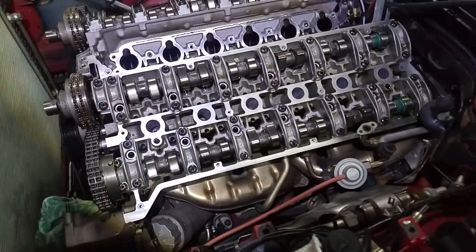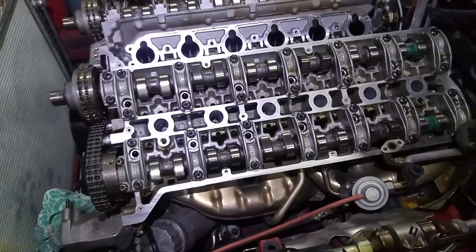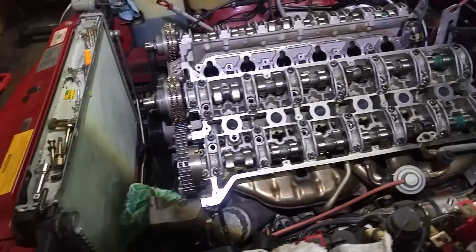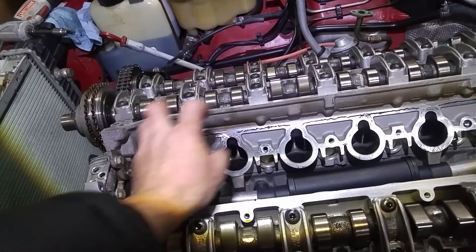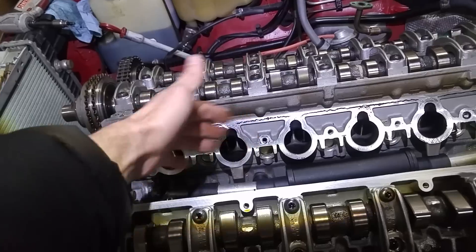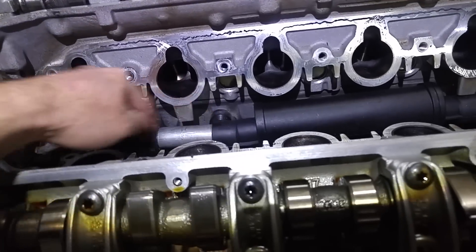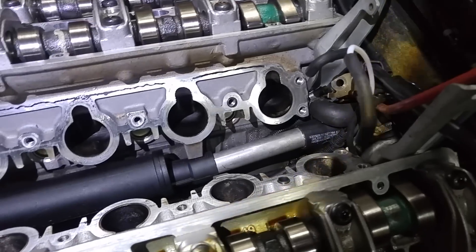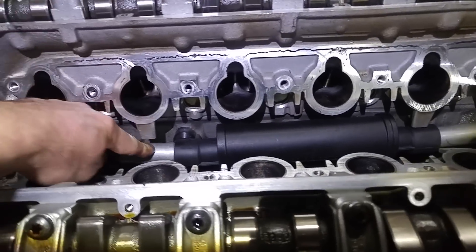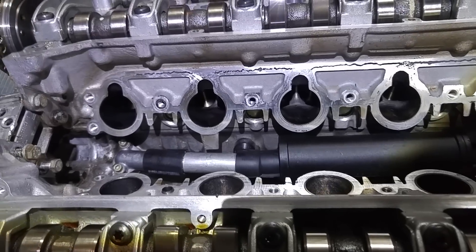Overall, the engine is just like it came out from the factory. The oil is very old, so it's very black — that has to be replaced once everything is put back together. I'm going to start removing all that silicone first, then put risers on, block off pipes. This pipe I replaced — this is the one that always breaks. That's already replaced; it's brand new. It's an updated version with aluminum and rubber versus just plain plastic as they used to be in '93.